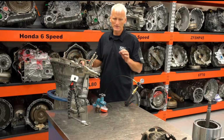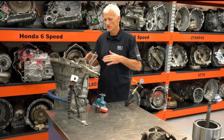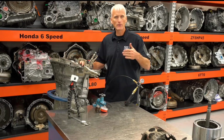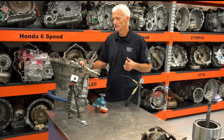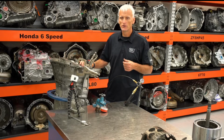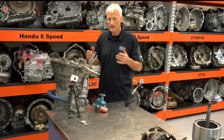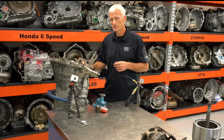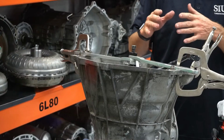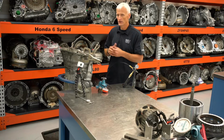Now, I think I'm only at the second thickest snap ring that's in there. There's at least 3 more thicknesses that are thicker, so for some reason, if this was the true measurement, even with the new clutch pack in there, every snap ring grows about 15 thousandths of an inch in thickness, and we're roughly 20 thousandths of an inch away, so if we upped it 2 sizes, that would decrease our clutch pack clearance by probably about 30 thousandths of an inch, which I'm sure would get us within spec. But like I said, in this situation, we'd want to have new steels and frictions on that clutch because those steels show those heat marks. So we could just assume that those frictions maybe have worn down a little bit.